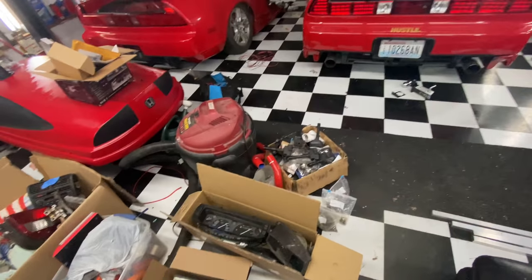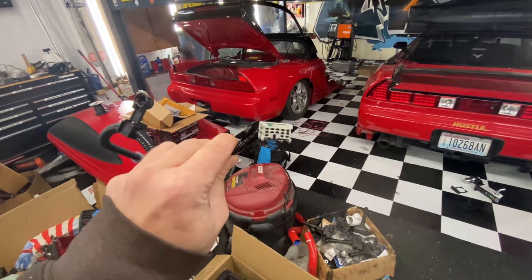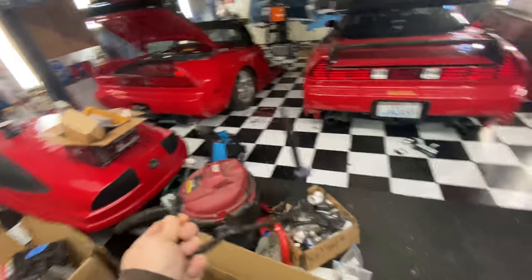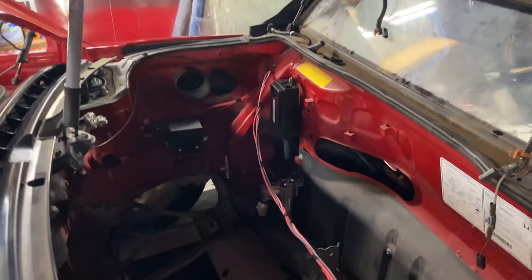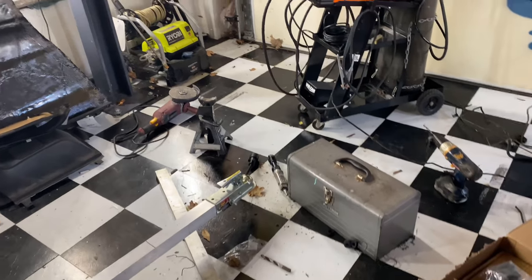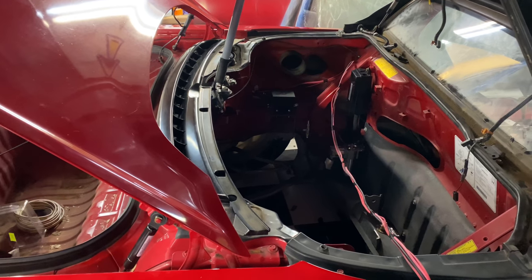So what I'm gonna do, and I'm gonna do most of this off camera because wiring is gonna be boring for you guys to watch, and I don't wanna put out bad content that's boring. So anyway, this is going to plug into one side of the taillights, and I have another one for that side, and I will wire these up to the junction box here, right there. And I ran the wiring through this already all the way to the front to a 7-pin connector. And so that's all gonna be color-coded. So if I ever need to trace anything, I'll know what's what. Everything will be labeled for, you know, tail lights, brake lights, reverse lights, blinkers, all that fun stuff.